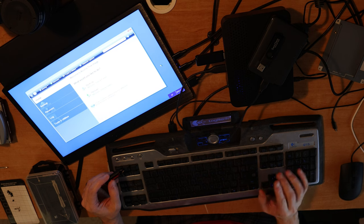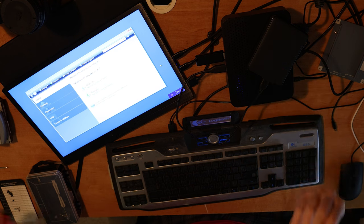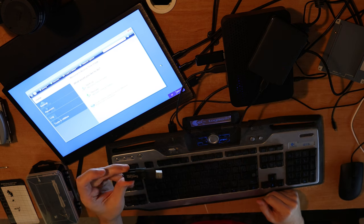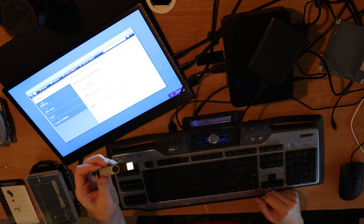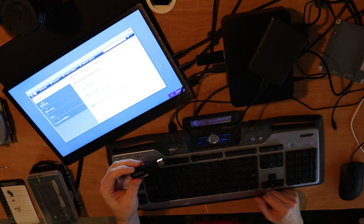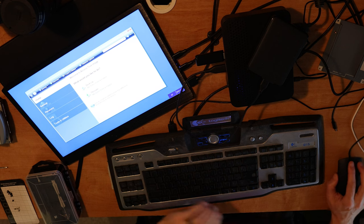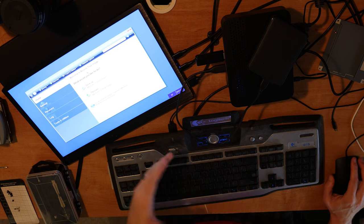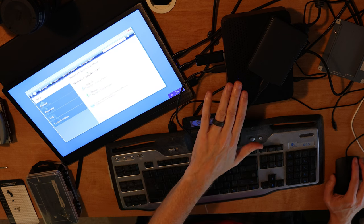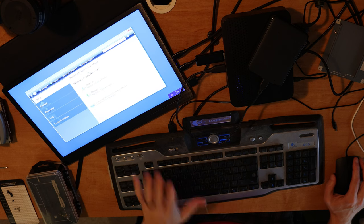So what I then tried to do was, since it booted up in the Kodlix just fine, I then used my Windows recovery drive, booted to that. It couldn't recover. Since it couldn't see that other partition, something was amiss. So what I'm going to do now, which I've already done, and I'm just going to show you, let me backtrack. I've already backed up the drive, and I'm going to put that backup onto another drive.